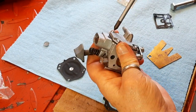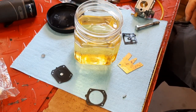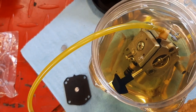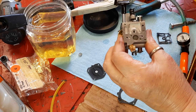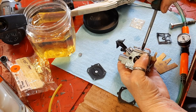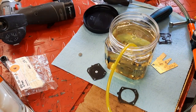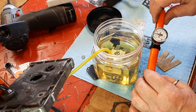I'm going to test this one more time in our gasoline pressure tester and make sure no bubbles are coming up anywhere. There is a tiny leak — a little couple of bubbles coming up from that corner right there. I'm going to pull that back out and address it. I think we're good there now — I don't see anything. Tighten that back down, put my pressure gauge back up, drop this in, give a little pump. It is not leaking at all — it's been sitting right at seven pounds of pressure for a good three or four minutes. I think we're good to go.